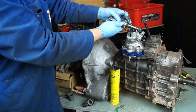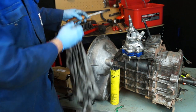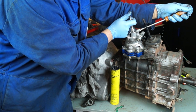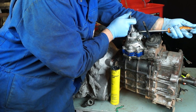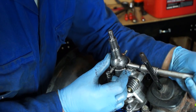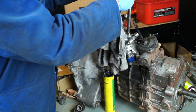Now, the slipper plate and spring. I'll be the first to admit it's not easy to fit — the first time it pinged off. Using a screwdriver to push it in doesn't work well; it needs to sit just below the surface. After struggling, a better solution is to use a socket of about the right size — a 9mm socket works — and push it squarely into the bore, which allows it to slip in nicely.